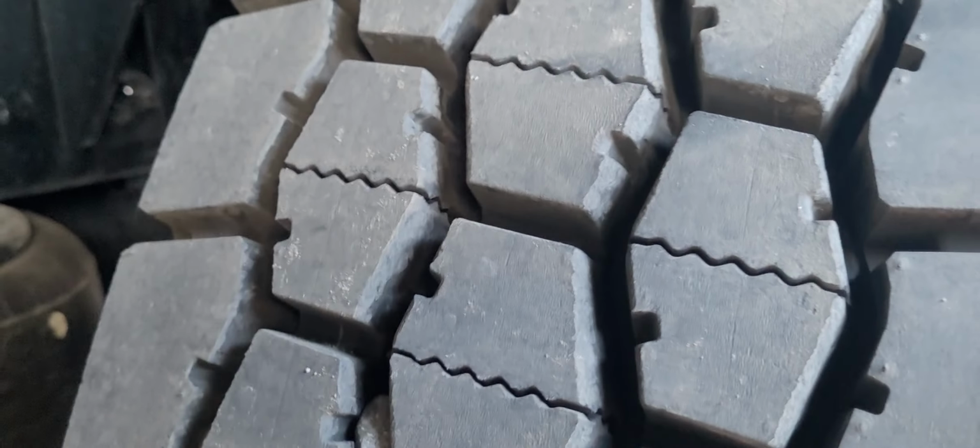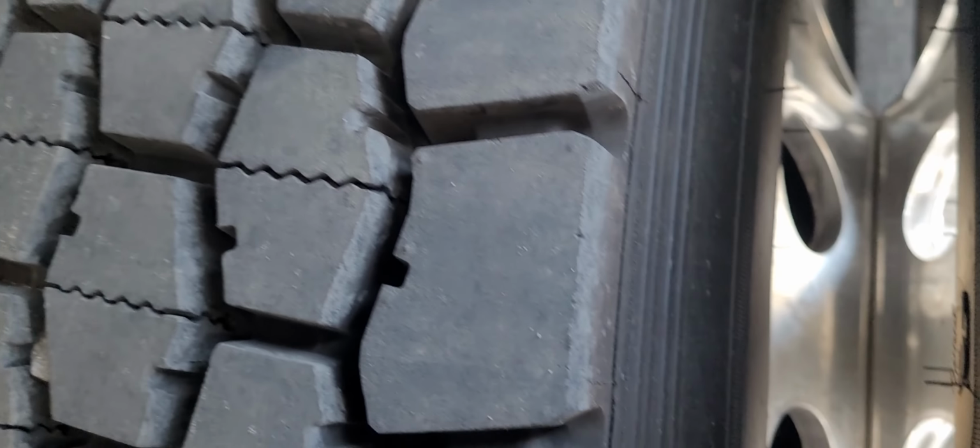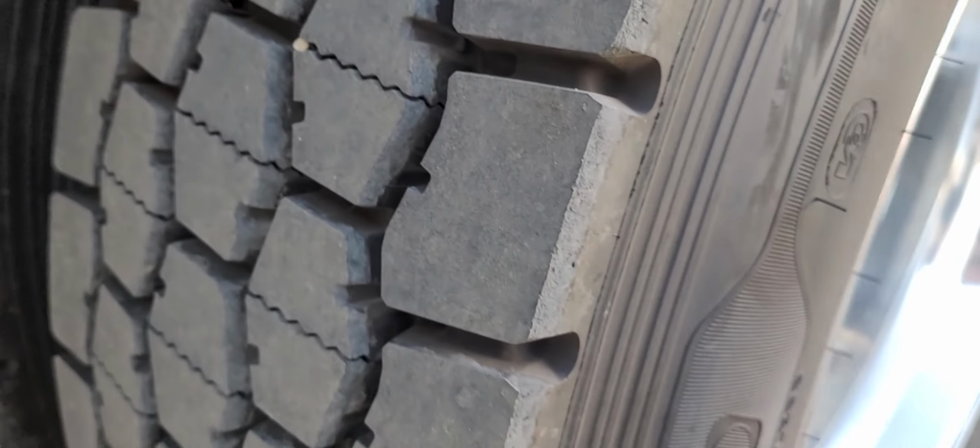Inside the wheel, dust covers are present. We could check brake shoe lining with a flashlight. Drums are good. Rims are in good condition. Tread depth is good. No debris between the wheels. Rims are flush mounted. No daylight or gap between the rims. Tread is good.